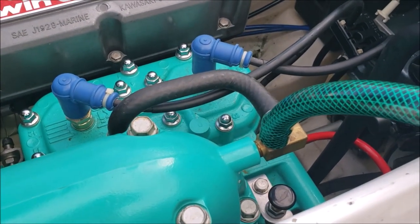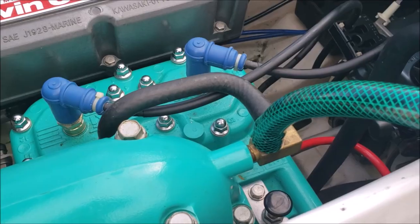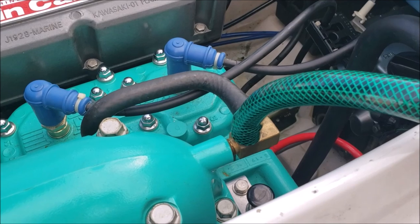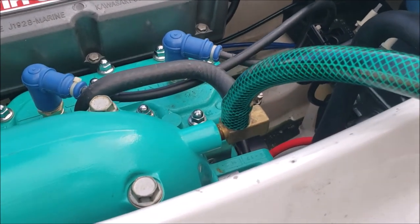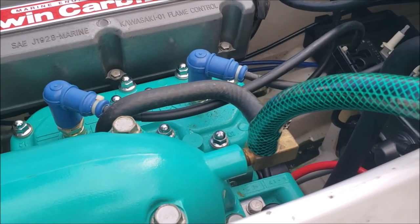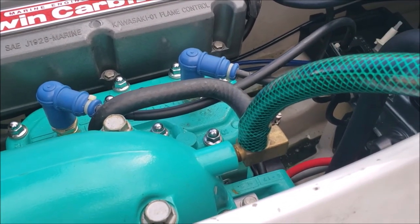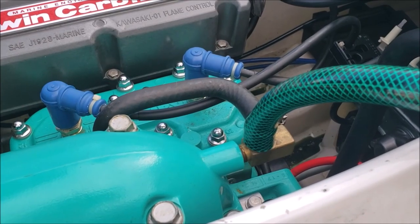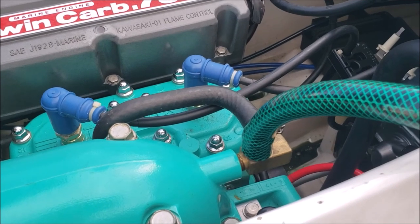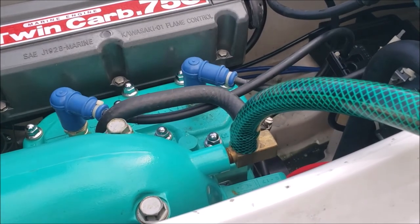Now an important tip: you don't want to turn the water on before you crank it. Supposedly on these 90s model jet skis, if you turn the water on before you crank the motor, you could actually push water back into the engine into places where water isn't supposed to be. I don't know 100% why that is, but I've heard don't do it. So to be safe, I've always cranked the engine and then turned on the water. This is cooling — it keeps your engine cool. It's not a problem to crank it and run it for a couple of seconds, because your engine is not going to jump from 70 or 80 degrees to 250 degrees within a second. You have enough time to crank it, let it idle, and then turn the water on.